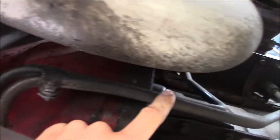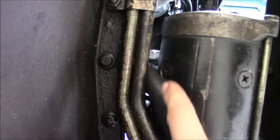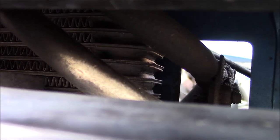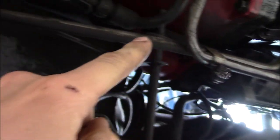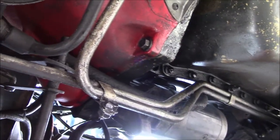Here we come across to the upper line, which goes to the rear port, comes back out of the heat exchanger, back across all the way over here, and then it's the outboard hard line which travels forward across the side of the radiator. The upper line goes to the driver side of the cooler, and the passenger side comes down the side of the radiator and becomes the inboard line, tracing all the way back into the transmission. That's the fluid flow to remember.